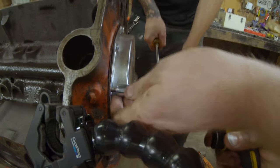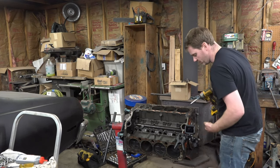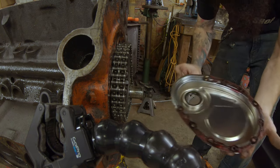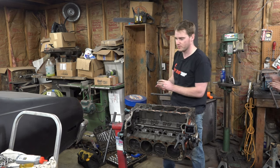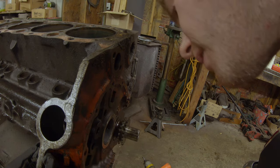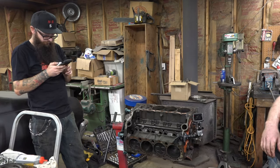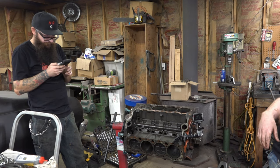Kind of funny — these old Chevy small blocks don't have threads in the end of the crankshaft for a damper bolt; they're just held on with the honor system. One thing we're also curious about is what kind of camshaft is in this. Before I put this in my Jeep the cam had a bunch of flat lobes, probably the factory cam, so I just slapped in one a friend gave me — generally not a good idea at 15. It turned out to be a CS112R: duration at 0.050 is 224/224, lift 0.436/0.436, lobe centerline 108, idle quality rough. It's actually a smaller cam than what's in the Nova — the Nova is 230/230 and 0.480/0.480.